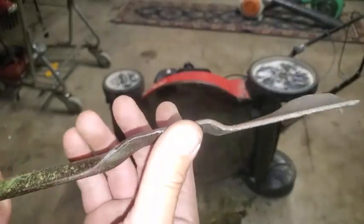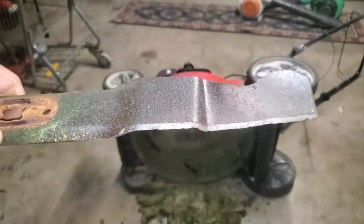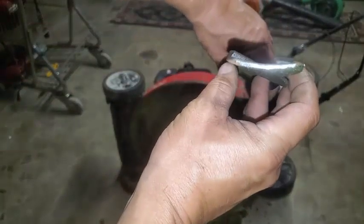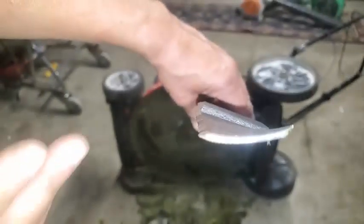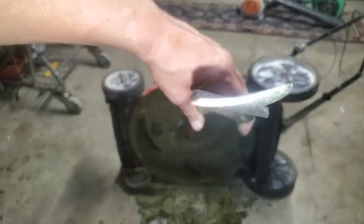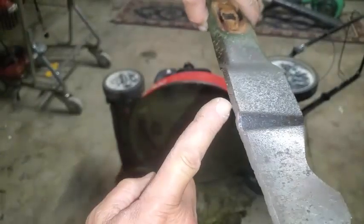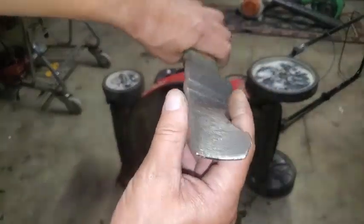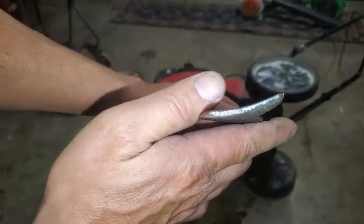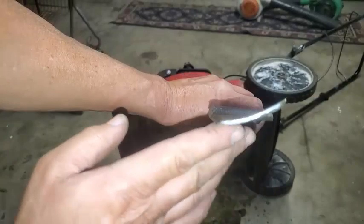When I sharpen these, you just sharpen one side — this side isn't sharpened. Lawnmower blades are sharpened only on one side, and what's important is the angle right at the tip. You want to try to maintain that angle. A good thing to do is to flatten it out first — flatten it all the way out to the end of the bevel, just straight and flat. You'll take some material off doing it. Then once you get it flat, follow the original angle and create a whole new bevel down to the edge of the flat that you just made.